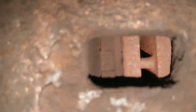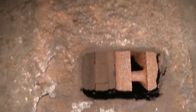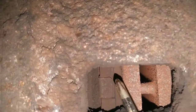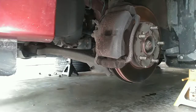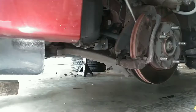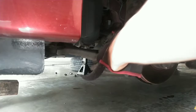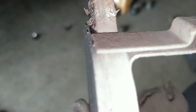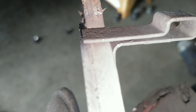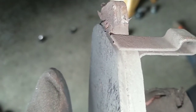And so is the inside pad, so I imagine the wear indicator, judging by this pad life left, is touching the rotor on the inside. And that's going to be warm. As you can see, that wear indicator is pretty close, so I'm 99% sure that was the noise.